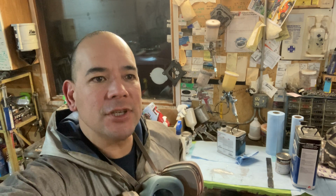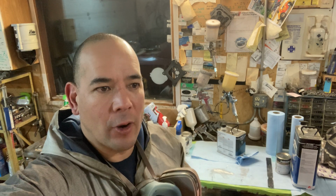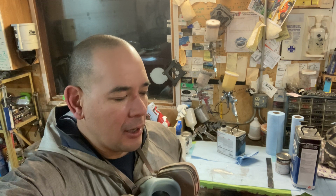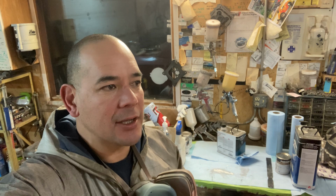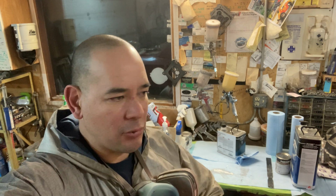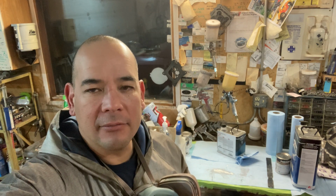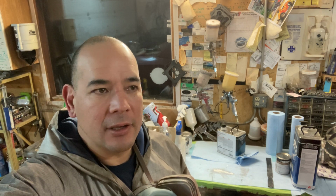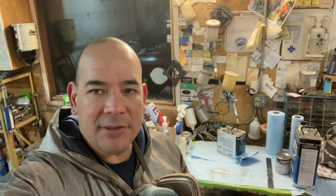So yeah, in the first video where I was sealing and basing these, I'm just talking about spraying something wet on wet. It just refers to what it is, wet on wet. You have something bare steel, or you have an area that you've sanded, you've prepped, it's ready, but you don't want to prime it and re-sand it again. So that's where the term wet on wet. You seal it, you let it flash off, set up, then if it was a single stage, you would just spray single stage, or if you're base clearing, then you apply your base coat, let that set up, and then clear coat. So basically it saves a step from sanding in between.